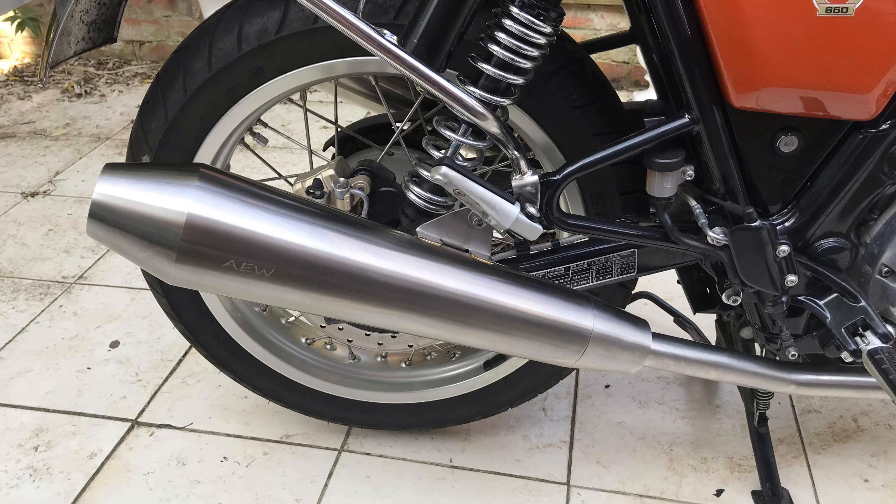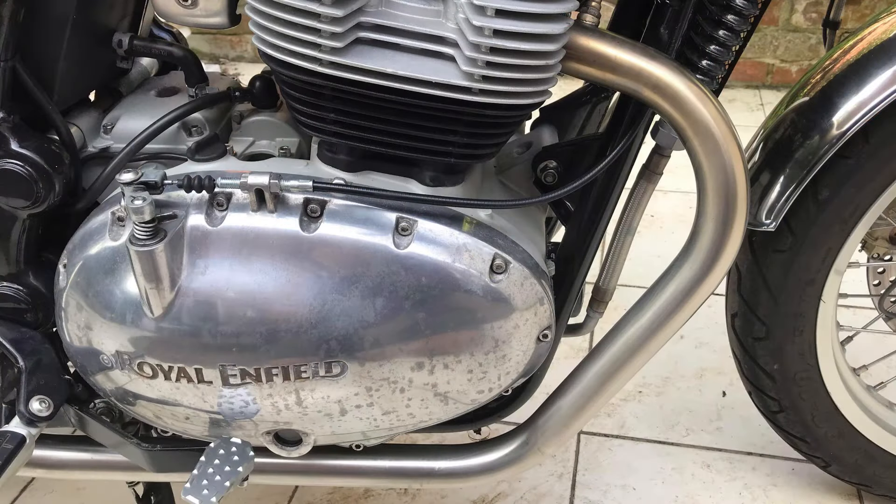I used a small amount of exhaust paste on the copper gaskets that were supplied with the Stratus headers. In the past I've put copper gaskets on with other exhaust systems and then heard that hissing leak — I didn't fancy that this time. The instructions that come with the Stratus headers say you can leave your old gaskets in if they're in good condition, but I preferred not to do that. Using a pointed implement carefully it's possible to get those original gaskets out, which I think makes the pipe sit better. It's only a couple of millimetres, but it still puts everything out a couple of mil. Everything went straight on, no messing.